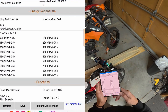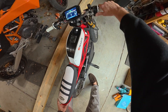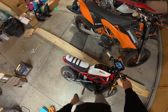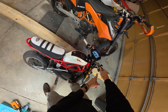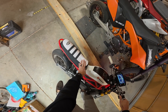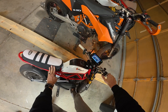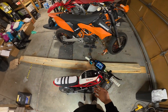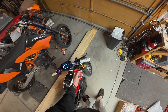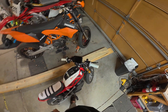It does slow you down pretty well. When we push this button we can see it activate on this screen. I don't think it's good using it on the stand because the wheel goes backwards — it's that strong — but I'll show you. There's revving it with no button... there's the button. Push the button and it slows it down. So it does work as a bit of a brake. It's not charging your bike and you're not going to get extra range by using this. It is just saving me some brake pads, to be honest — that's what I'm using it for, and it's a cool feature.